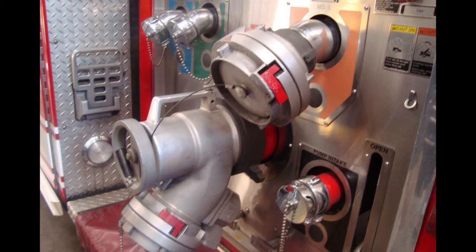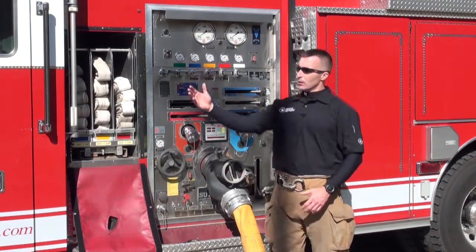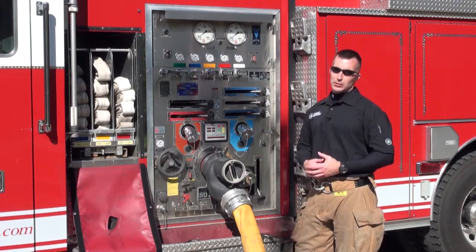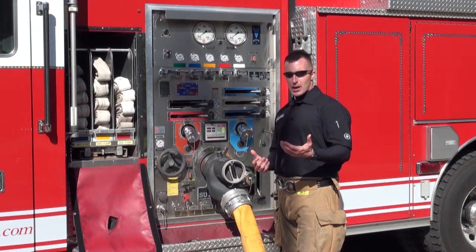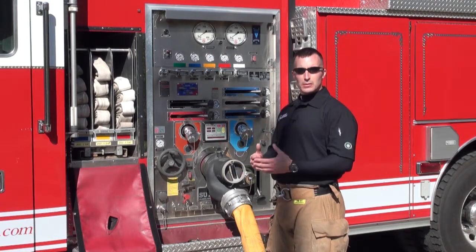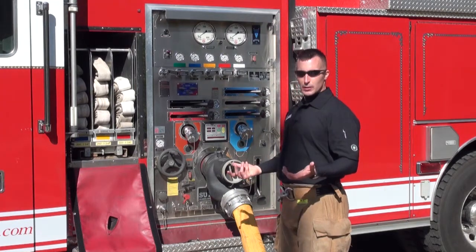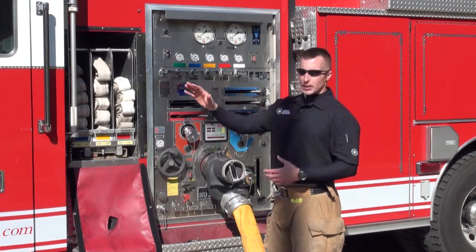Running down the side of the pump, most of the time you'll have some type of cab tilt control, as well as possibly a manual shift linkage for the pump in case there's a problem up in the cab with the air shift. We can shift or override that manually here at the pump panel. Air is very reliable and has been for a long time, but everything mechanical tends to break down at some point. Having that secondary backup to shift the pump from road into pump gear is very important in the event of a problem with the transfer valve or transfer switch in the cab.